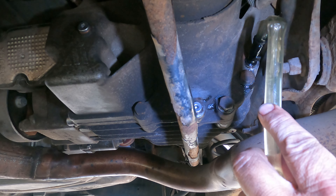Same again — fitting a new plug. Let's connect our hose to the fill hole and fill it full of fresh fluid. As you can see it's overflowing, so we know we've got enough in there. Fit another new plug and torque that to 15 Newton metres.